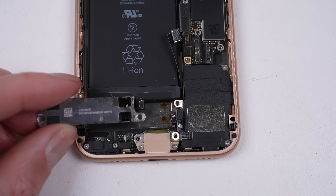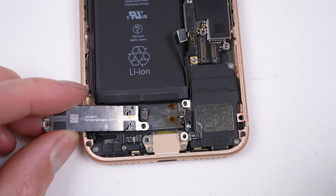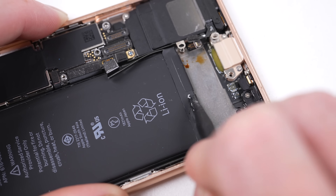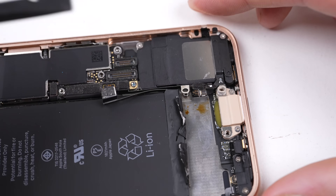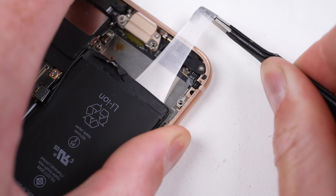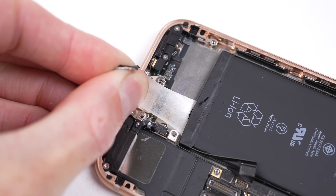The Taptic engine — Apple's fancy name for a vibration motor — is like an old car: this engine is leaking oil. I can't say as though I've ever seen a haptic motor do that before. I'll begin removing the adhesive on the battery. Apple has improved the rigidity of this adhesive in later models, reducing its chance of snapping, but that doesn't help us here. As soon as the adhesive caught the bottom of the battery while removing it, the tab snapped, leaving the battery firmly stuck in position.